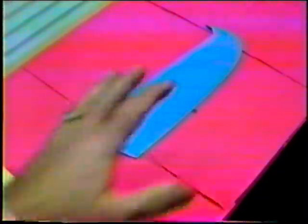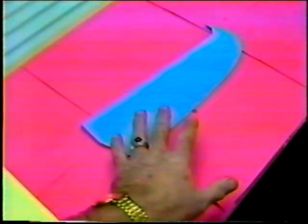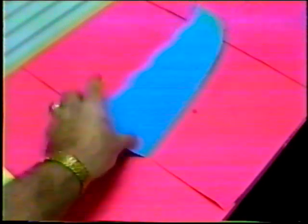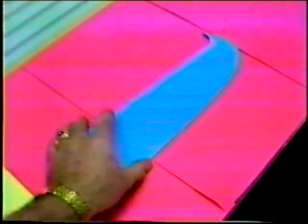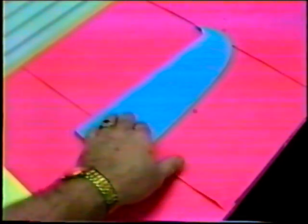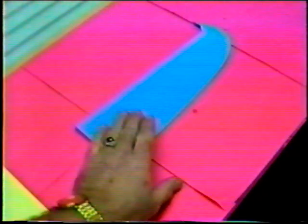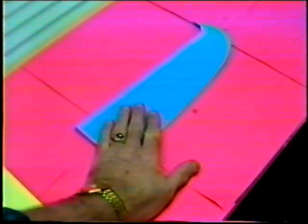Now it's good to always start, of course, on the bottom. Even if you screw this up, it won't be a problem. Hey, by the way, this is another quick thought. Because we already have one coat of clear on here, if you don't have any clear, that ink really tends to get into the pigmented paint if it's chalky. So here's even another advantage while we're inking it. I want to just touch this with 600 paper and then wipe it with M600 first, the first step.